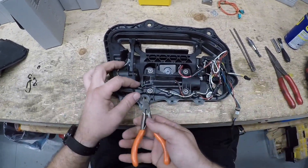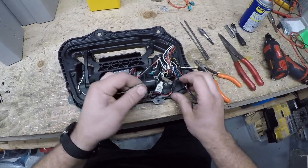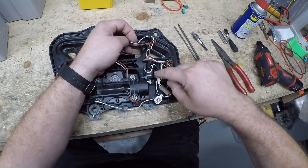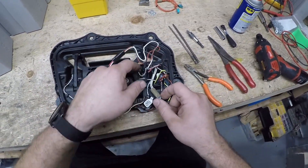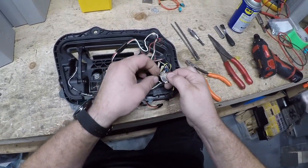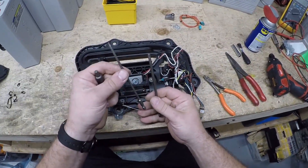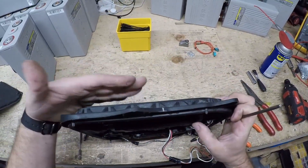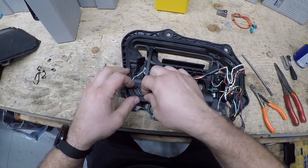In order to take this apart further we need to take the motor out. We'll cut the zip ties on the housing, undo the wires — this is all going to get retied up better than it was. This is your switch harness. They do loop the switch harness under the other switch, so be careful — that wire goes straight into the module with no connectors, so it's not replaceable. Unplug the motor and the switch harness. You'll need three Torx bits: a T10, a T25, and a T40.